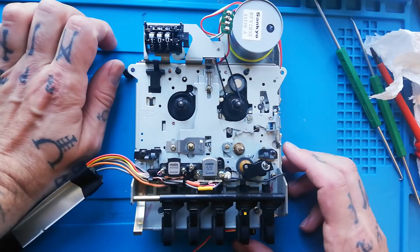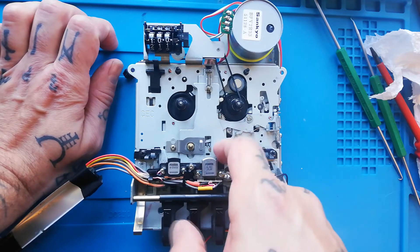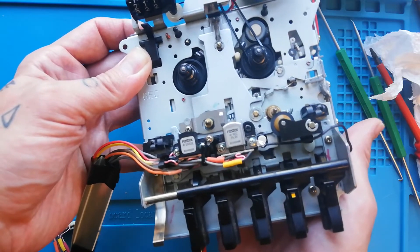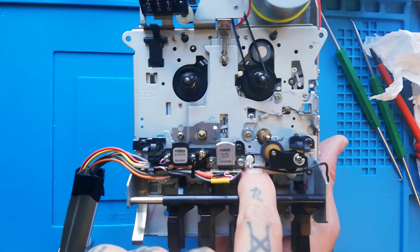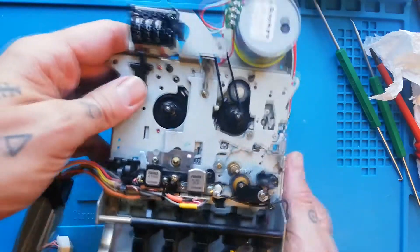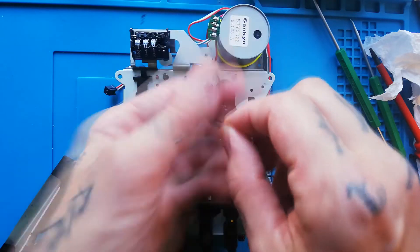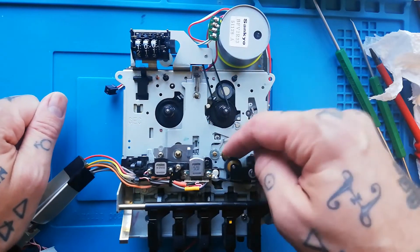If the problem still persists, the likelihood is that there's an issue with this black plastic part underneath the magnetic heads. That's called the head base. If I put this into play here and manually turn the flywheel, you can see that all of that has been lifted by a white part here — that's part of the gear assembly — exerting pressure up against this protruding black spring. The spring is this shape, and the recess for this shorter arm breaks, so there isn't enough push of this white part against that spring to force the pinch roller to make contact with the capstan.